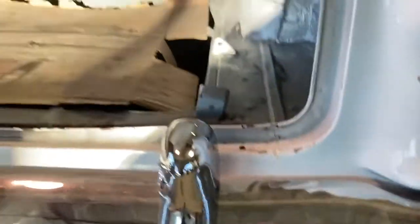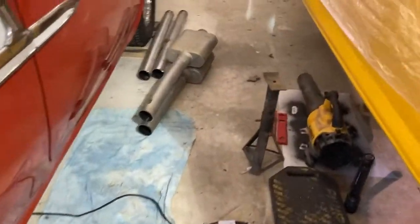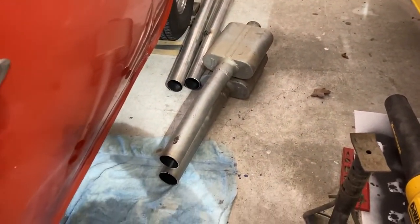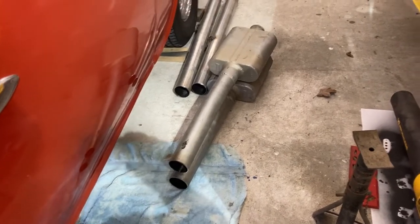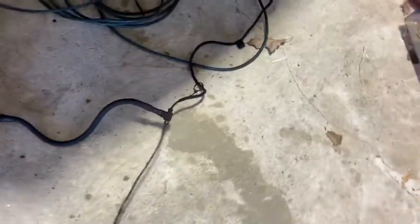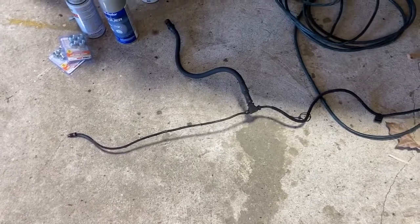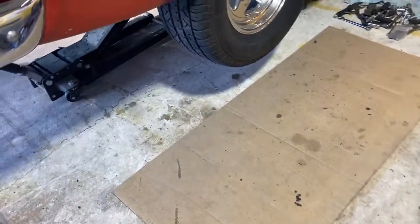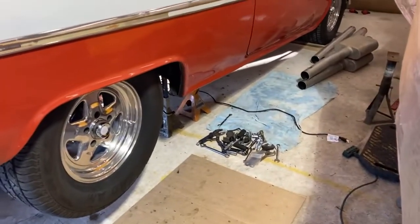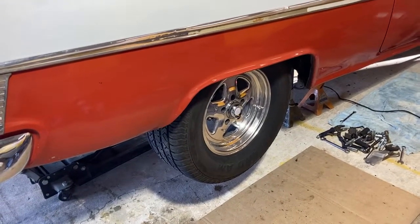Probably won't have to vary off too much from where it is right now. But I'm going to get to work on these mufflers — this is all three-inch. If you remember, that LS engine is up in there. I'll get that all back up under there, get the driveshaft fixed up, get these brakes and a new brake line. This little brake line I took off — this is what was on there, shaped to go around that 12-bolt. I'm going to put a new brake line, mold it up around that rear end, and off we go. He's pretty happy — I sent him some pictures. Once I get it back on the ground before it heads out of here, I'll let you see that too.